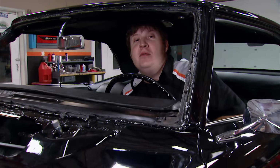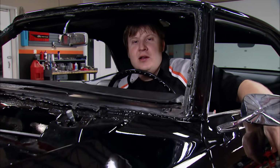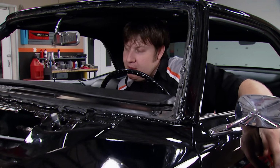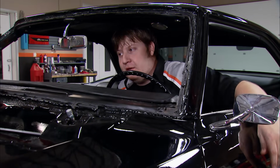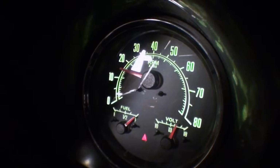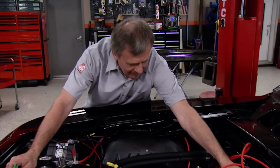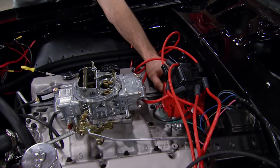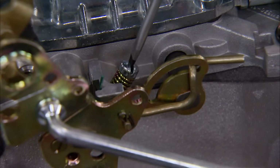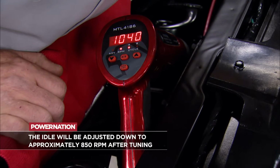I'm gonna do a very important role, sit here in the interior and be comfortable, but I'm gonna be checking on the gauges to make sure if things head south, I'll know it before it gets bad. And Mankford, he's gonna do some tuning out there. Now this is when you bring the motor up to temperature to begin the break-in process. We'll be doing some initial engine tuning while we're at it, but you wanna move pretty quickly to get it all set. You can start by tuning it by ear. Then you also adjust the idle screw to bring the engine up to a good RPM range for what we're doing right now.